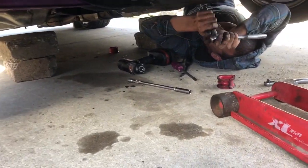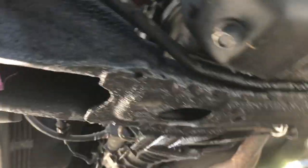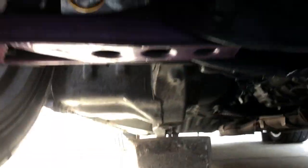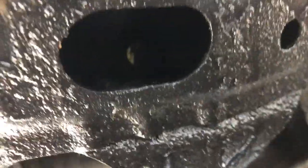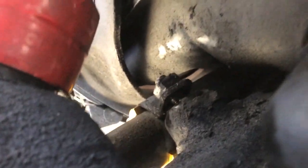Some videos don't show where things are located, and since I'm still learning, I probably wouldn't know where the steering rack bushings are either — so I'm going to take you guys on a little cruise to show you. What we used was a 17-millimeter socket to take these bolts out, and you're going to need an extension. From the motor mount you'll see the LCA, and you literally just come across here — one and two — and it's right up here.